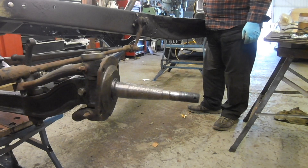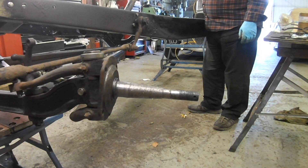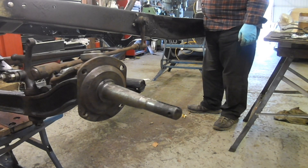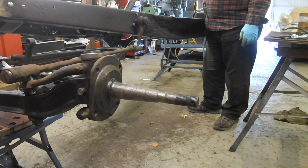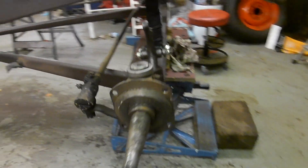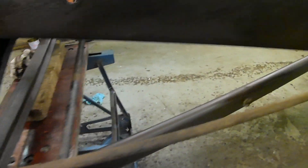There's not really a lot to the steering. Just make sure all the joints are in good condition, all the balls are nice and clean, make sure the kingpins are good, bushings are good — I've got a reamer for the bushings. I know the steering box is okay because I've had it apart and had a look at it. The track rod has a left-hand thread one end and a right-hand thread the other, so you turn the rod to adjust the length. You can't adjust the drag link — the drag link is non-adjustable.